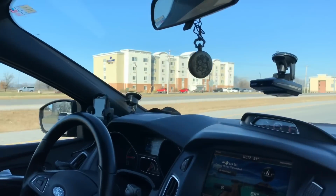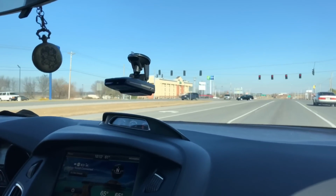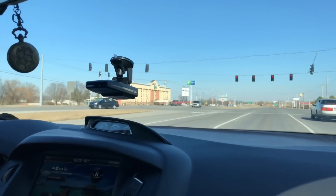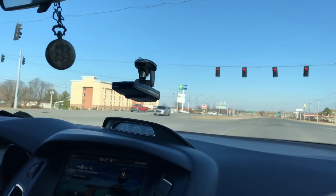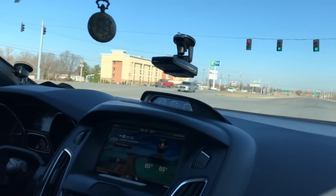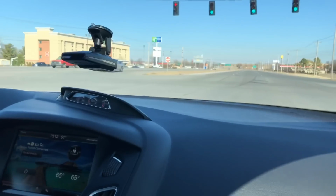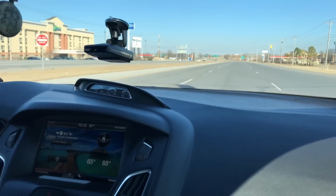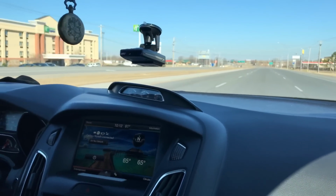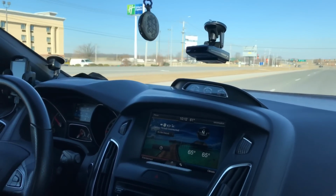For people who are not planning on building their motor and are just staying stock 2.0 EcoBoost, you still think it's a good choice? I think it's perfect, because it's becoming more prevalent that you can push these motors to right around 400 wheel horsepower without really any problems. For anybody looking to do an ethanol, like an E30 setup, the 2867 will put you right around that 400 wheel horsepower, no problem. And then on 93, you'll make 350 all day.